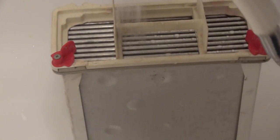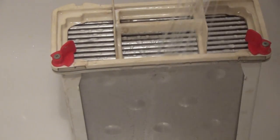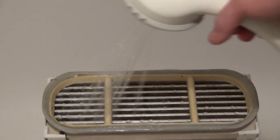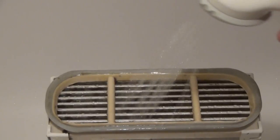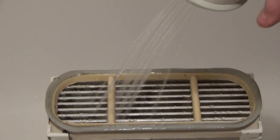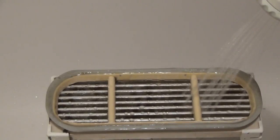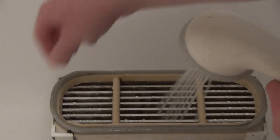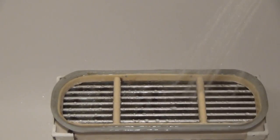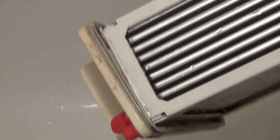It's unlikely you'll see much muck come out as it's already been cleaned. You can start at the front and go backwards, or turn it round and go from back to front. If it hasn't been done for a while, get a boiling hot kettle — the hotter the water, the easier the fluff comes off. Pour it through several times, but be careful not to burn yourself. If it hasn't been done for a few years, also do the sides, pushing water through the fins, as you can get building fluff in between them.